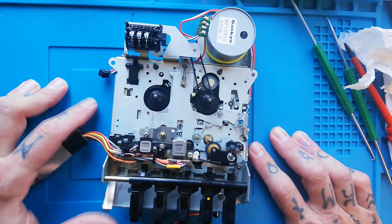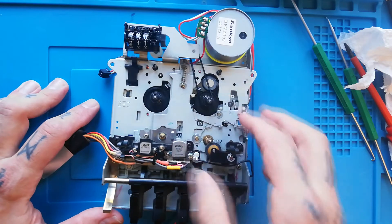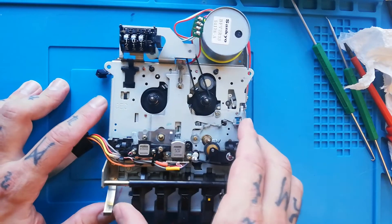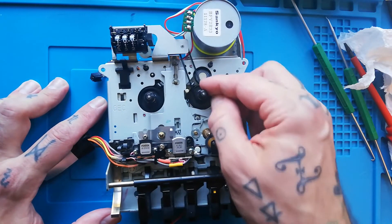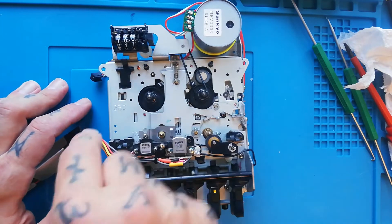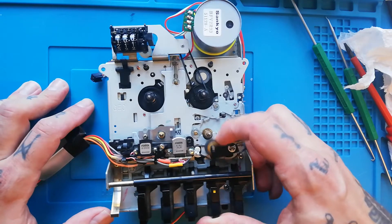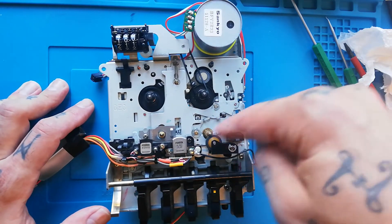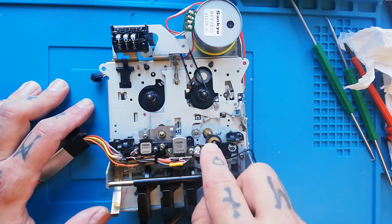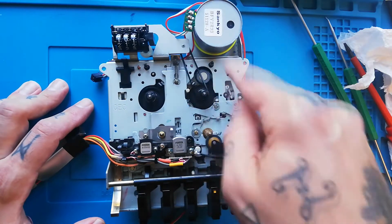The other category of problem is: although the pinch roller engages with the capstan fine, this idler wheel — which is responsible for turning the take-up reel in playback mode — doesn't connect with the take-up reel properly, or only does so intermittently. What you'll find is that the tape is being drawn across the heads and between the pinch roller and capstan fine, but it starts to billow, build up, and possibly get tangled or chewed up because the take-up reel isn't turning fast enough to wind up the tape.